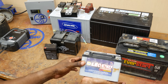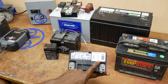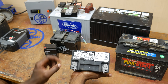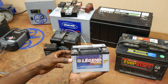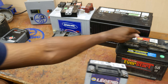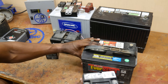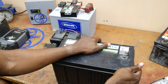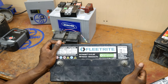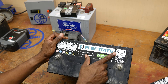This battery, which just came off of the go-kart that I'm converting to electric, has cold crank amps of 120 amps. That makes sense because the anatomy of this battery is a lot smaller, so there won't be nearly as much surface area to produce electricity. This massive battery is also a starting battery — the type you might find in a tractor trailer — and the cold crank amps are 700 in this case.